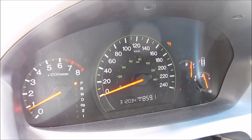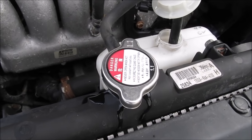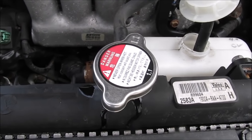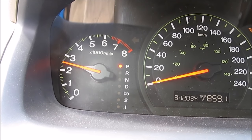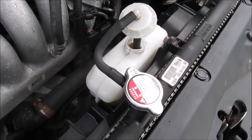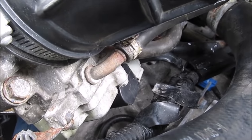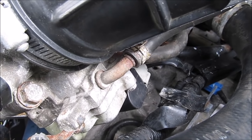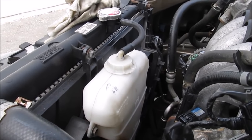During this time the computer will relearn idle with the new clean throttle body and idle air control valve. You can see the steam escaping and bubbles coming out. You can also speed up the process by holding the RPMs a little bit higher. The coolant system has now been bled — you can close everything back up. Make sure you check for leaks near the throttle body where you disconnected the coolant lines. Finally, double check and top up the coolant levels in both the reservoir and the radiator.